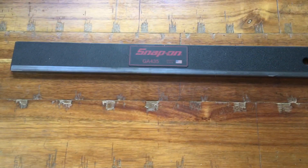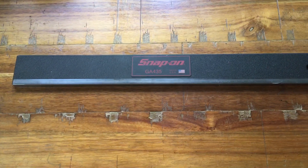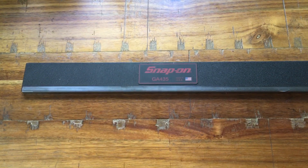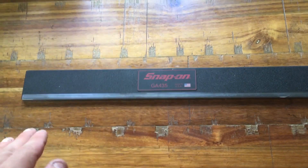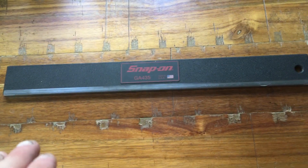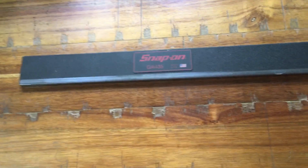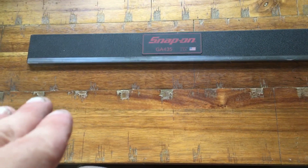The rule of thumb for aluminum is two thousandths of an inch, and that goes for both the head and the block. What I've been checking for the longest time is using three thousandths of an inch. You put the straight edge at the angles you're supposed to on the head or block and try to slide the three-thou feeler gauge under — if it won't slide under, that's good, it's a straight block. If you're finding gaps where it fits in, you could have a serious problem.